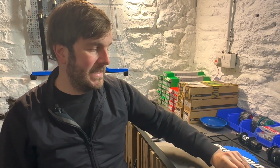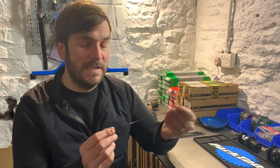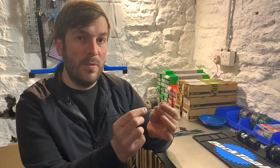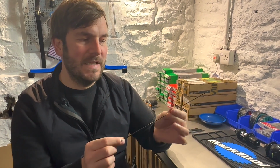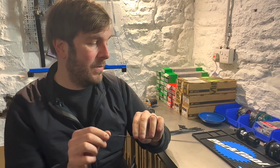We're going to bring all of these together with DT Swiss Competition double-butted spokes. So they're 2mm here and 2mm here, and they go thin, so they're 1.8mm in the middle. This just means they can handle absorption and shock a lot better than a single butted spoke.